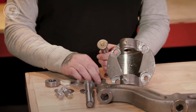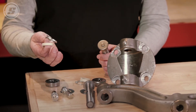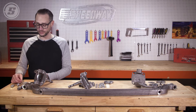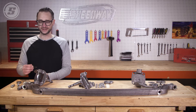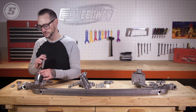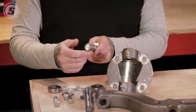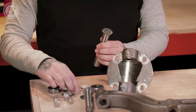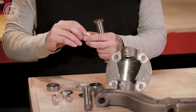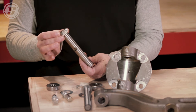When you get your parts you'll see that you have a couple of little pieces and parts. We've got some bearings, some kingpin stops, felt washers with caps, as well as some shims. The kingpin has a notch in it — it's got to be aligned with the axle in order to hold it in. You're going to put a cap on with the lip facing down, and a felt washer will go under the cap.